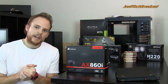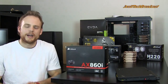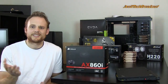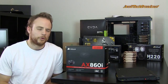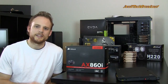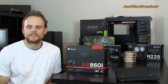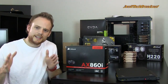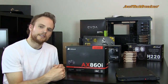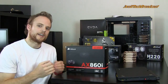The first thing I actually look at is the graphics card you either have or are wanting to get. Many of them, if you go to any website to buy them, usually have a minimum requirement for power. For example, I know the GTX Titan is like 600 watts. So you're not going to need much more than a 600-watt power supply. I usually recommend getting a little bit better — if you need 600 watts minimum, get a 750 or 760-watt power supply because the price difference isn't that much. I'd rather spend 10 to 15 dollars more and get a higher-end power supply with a little bit more wattage than cheap out.